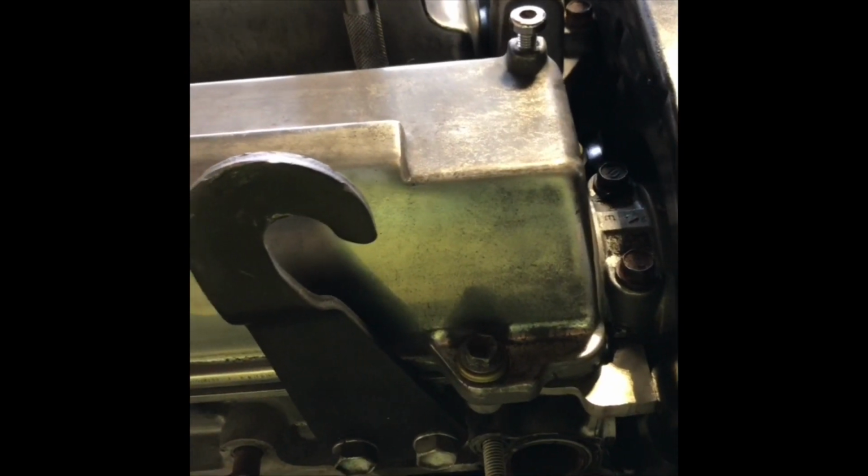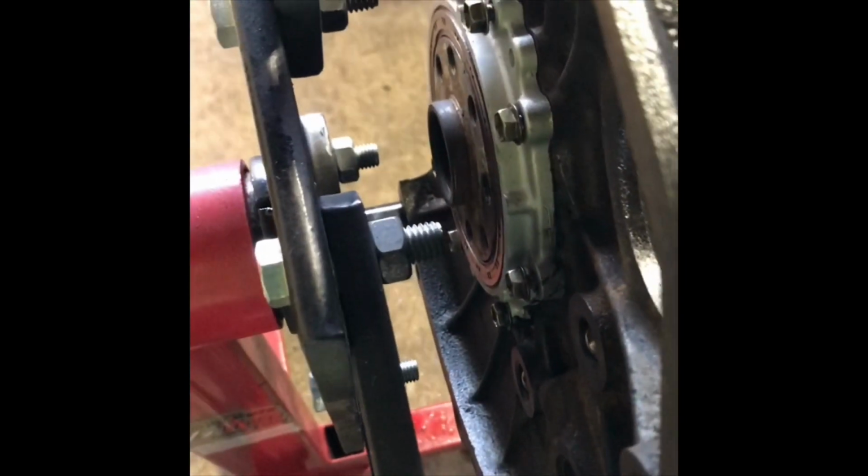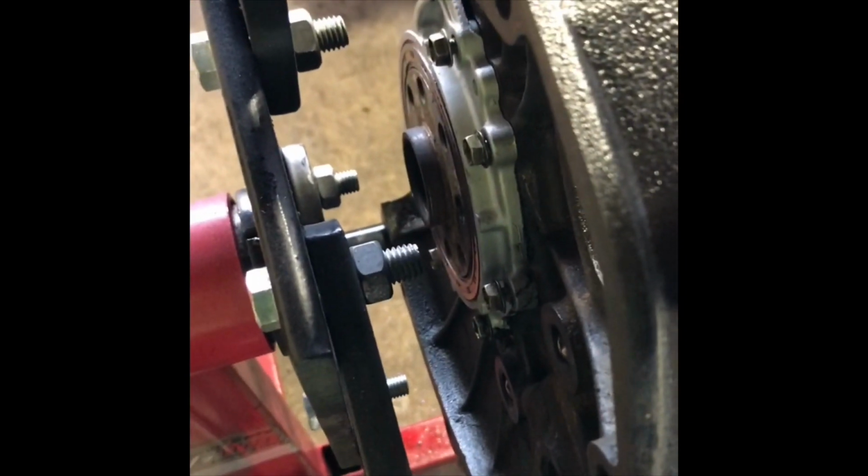Easy as that. I'm going to set your torque wrench to 74 inch-pounds for the valve cover bolts. Little blue Loctite. Your main seal is in. When you put it on there, you want it to be flush with that bracket that it goes mounted into. I just used a level and a mallet and it worked out pretty great how I got it to seat in there. So that's just a little bit of advice for you.